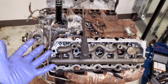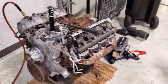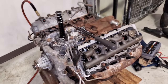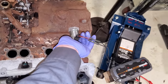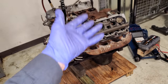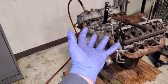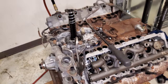This is something I wanted to highlight for you guys. I don't know if everybody has had to do their air leak test, but this can be done at home or at the dealer. You are going to need shop air to perform this test. If you didn't have the connector shell, you could rig something up with pins. This has obviously worked out well for me. Tell me what you think in the comments — if you've done this to your own truck or paid someone to diagnose your 6-liter high pressure oil leak. Thanks for watching, like, comment, subscribe, and share. See you guys next Friday — 6-liters out!